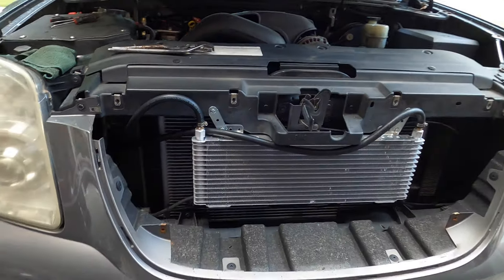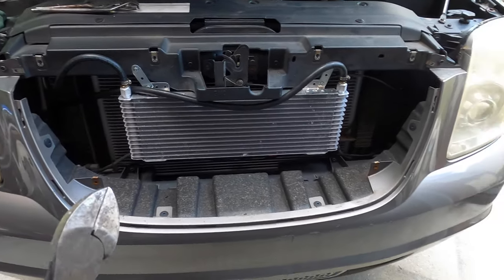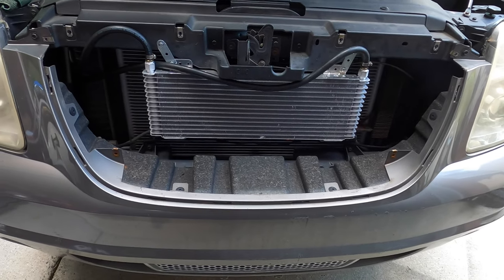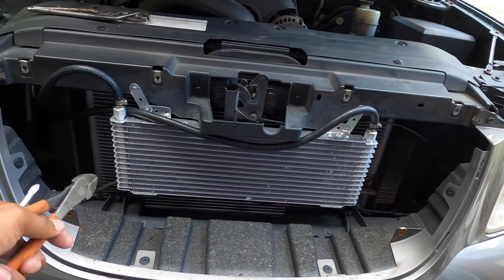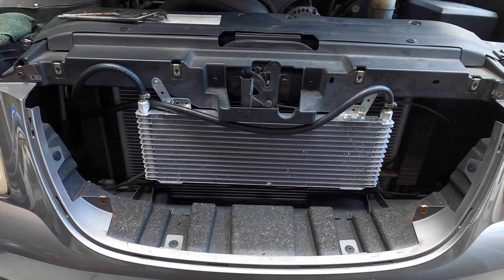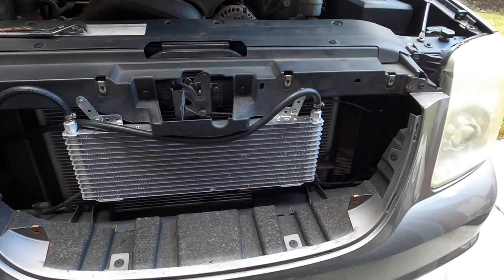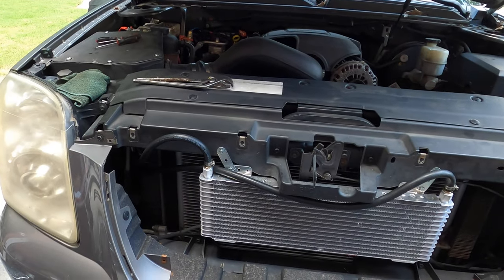Everything is now connected. The advice is don't add any transmission fluid until after it runs for a bit — the consensus is people add about half a quart to a quart over about 300-400 miles. Initially, do not pre-fill anything, just install everything dry and then check it every 50-60 miles and add as needed until the system is fully primed. I'm going to check all my connections, zip tie the bottom, and then we're going to start it up and check for any potential leaks.